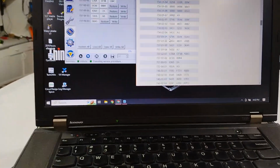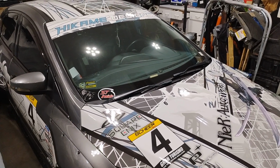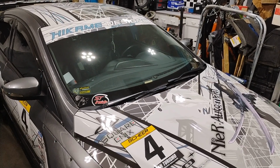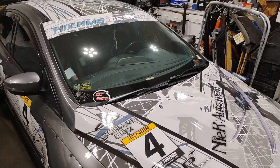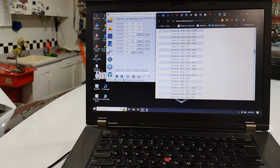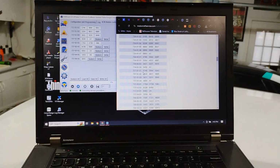Something else you can do, which is what I ended up doing on this car, because I put in the ST3 seats, and that's an ST1. I just loaded the as-built data from an ST3 restraint module to that car, and then it got rid of the bag light. That way you don't have to swap the passenger occupant sensor. Something kind of neat there. You do have to have the extended version of FORScan to make it work, which I think is basically free anyway. But yeah, something you can do.